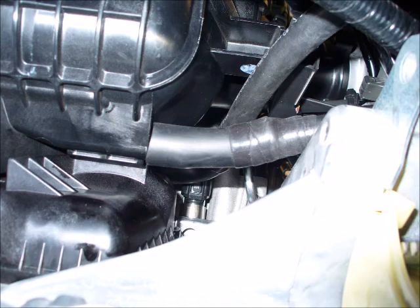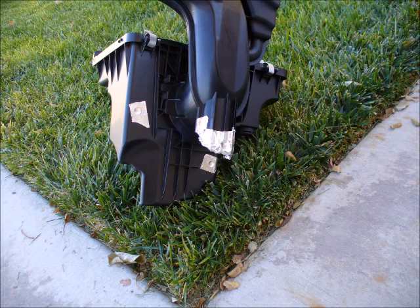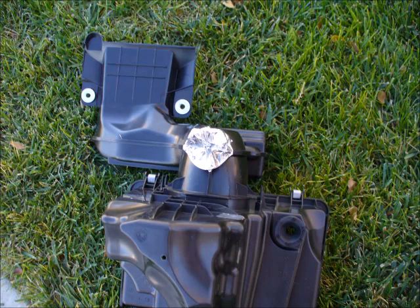Here I have the lower line connected to the intake manifold. You may notice I have the upper line coming down instead of going up around the hard lines and across the top of the transmission — this is also with the starter removed. All I had at the time was aluminum tape to cap that off; I expect I'll eventually find a plastic cap. It's not exposed to excessive vacuum so it should be fine. I removed the resonator to allow more room for the vent lines underneath the airbox.